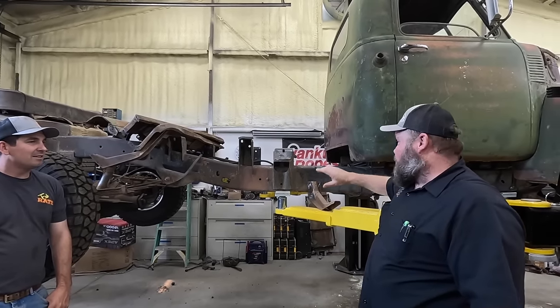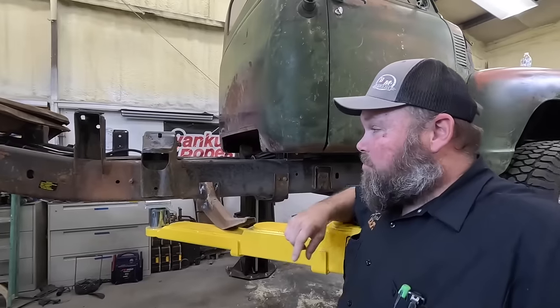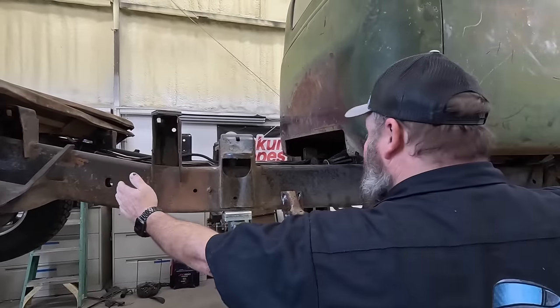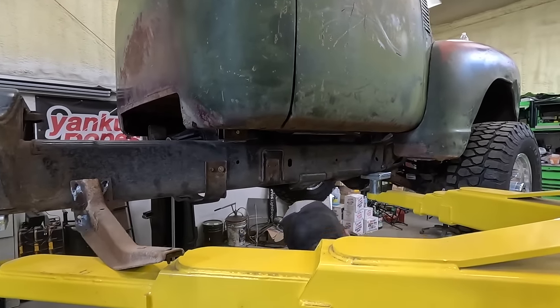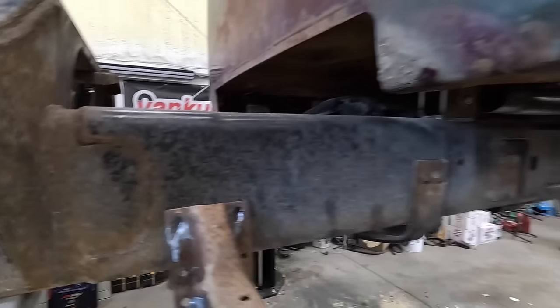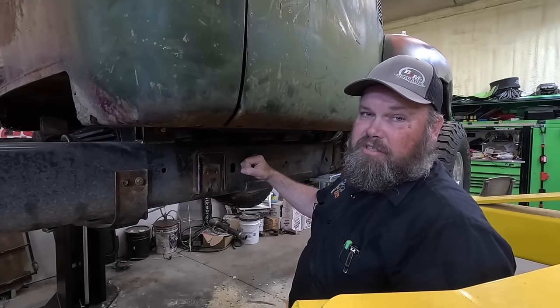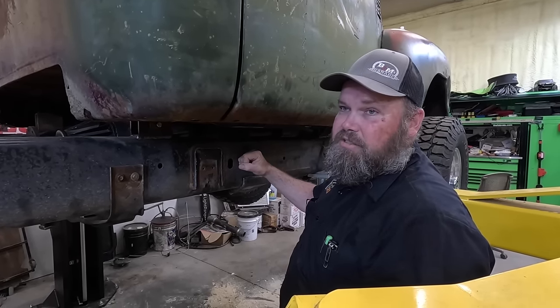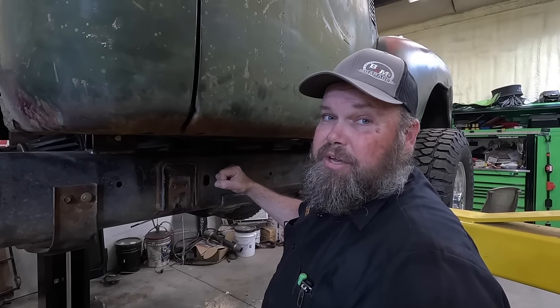It's rollback day. It's time to get her going. We've got to get some more plates on it, get some running boards on it, but we got to go get some steel. We're plating it from clear back here, clear up. These Dodges have this section right here that are pieced together. And as much force we're going to put on this truck, it's going to break, guaranteed. So we better plate it. We got the plate up to Mom's house, so we got to go get it.